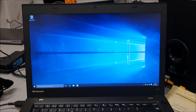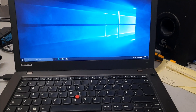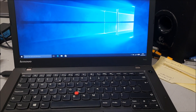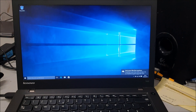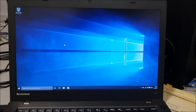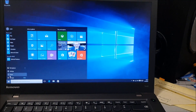What I'm going to do is show you how to put a new hard drive in, how to disable the little 16 gig card on the inside. I'm going to put a bigger 500 gig SSD in this machine. First thing to do is shut the machine down and restart it pressing the F12 key.